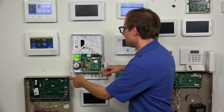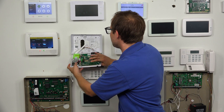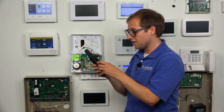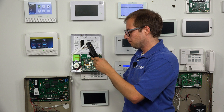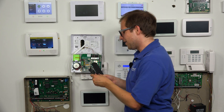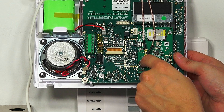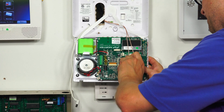The system is powered down because we undid it through the barrel connection. Make sure you do that before making any hardware changes — very important. So we have our antenna right here, let's get it attached. We're going to take off the cable tie. We have our connector piece, and we want it to go into the main port. You can see there's div and there's main. We're going to take out the main one and set that aside.